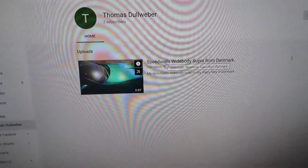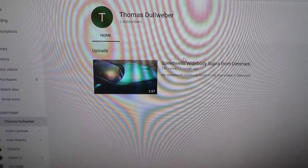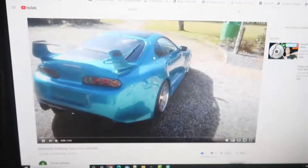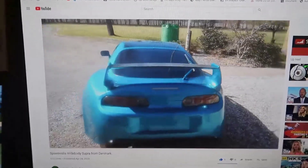What's up guys, one more video that I didn't want to make. Apparently I timed my engine through the wrong mark. The sprockets have two marks — a dot and a line — and apparently I should time by the line. There's this guy, Thomas, and shout out to him. He has this dope Supra and he made a comment on my video.